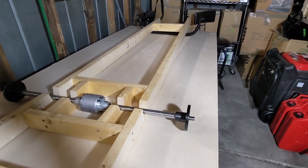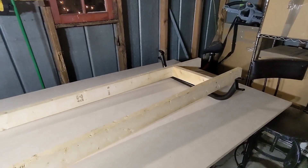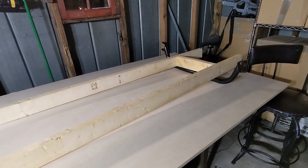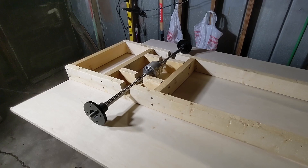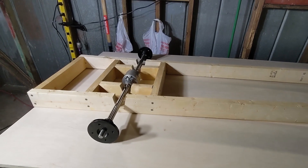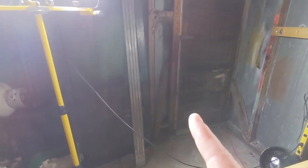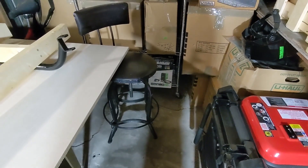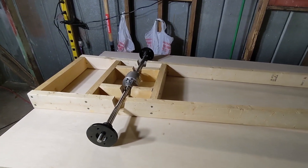Some people go up to 68 inches, but it really impacts your turning radius and this is already 93 inches — it's 8 feet long. So 62 to 64 inches is kind of preferred. I think the Stevenson formula says 64 inches, and a lot of people like to go just a little bit below that. This is just the wooden mockup while I was waiting for the last of my suspension parts to arrive, which they have. So we'll get started welding this stuff up — my welding hood and flux core welder — we'll get this laid out and come back soon.